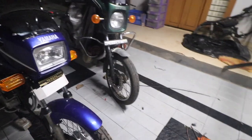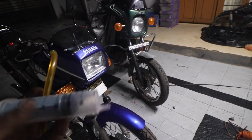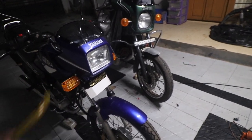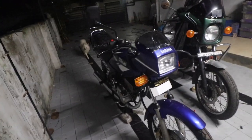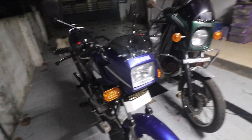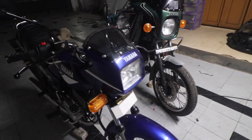One of our subscribers had actually discussed reverse bleeding. For reverse bleeding, you need a tube like this and a syringe. I have a 60 ml syringe which I'm going to use explicitly for this, and you also need brake fluid. I have a can of brake fluid. So what we need to do is open the bleed valve, and through the syringe push the brake fluid in. For that I need both hands.